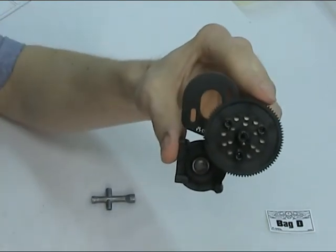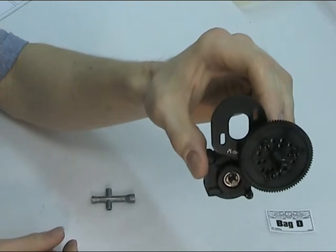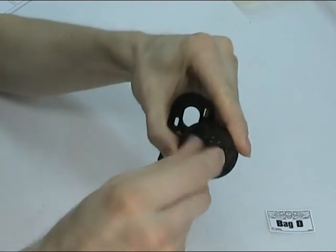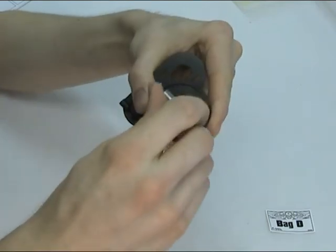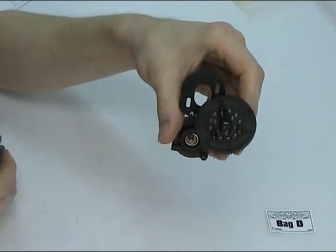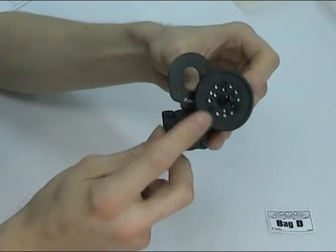To get the bolt to bite, just rest one finger on the gear, push down on the bolt and twist it — that should just take up a couple of threads. Now what we need to do is actually set the slipper clutch correctly. We need to tighten the nut on the front clockwise — so to the right — again holding the gear, until it's tight and won't tighten anymore. When you get to that point, we need to then loosen it two turns anti-clockwise — counter-clockwise, to the left. So we go one, two. That should then have set the slipper correctly.